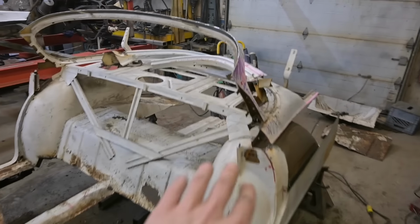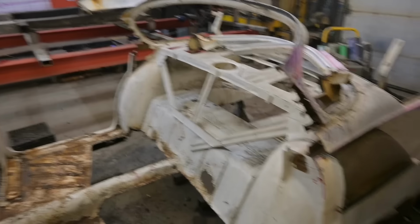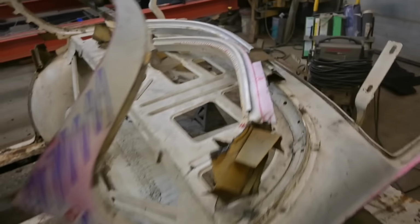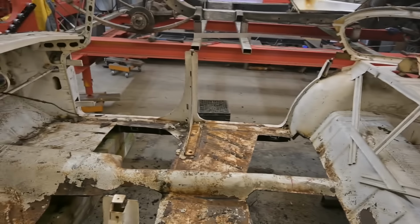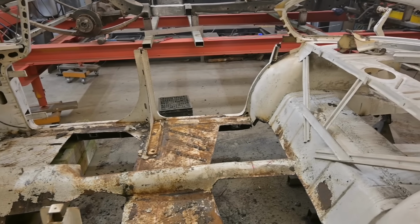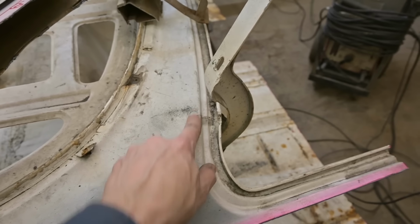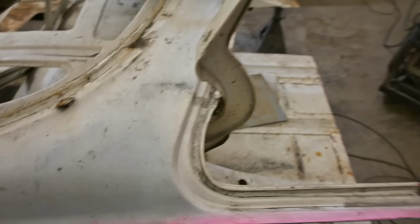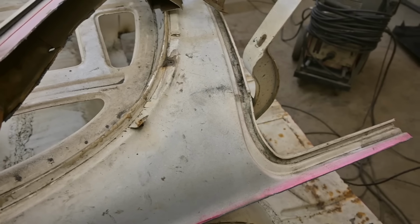Oh yeah, and these arches over the rear window or the back door window are gone now. They're laying up there. So we're gonna have to re-bend those, soften them up a bit, and reinstall them further ahead to allow for a more graceful side appearance. Check this out. Right where the trunk hinge is, there's a stress fracture in the bodywork, in the metal. So we'll have to address that later. Just a weak spot in the body. Okay, let's do some more cutting.